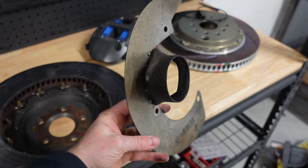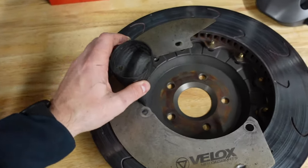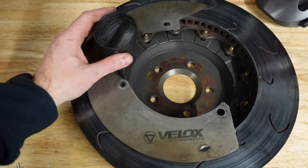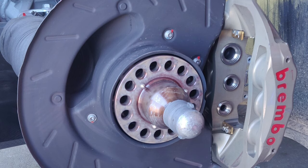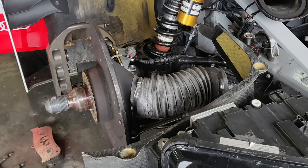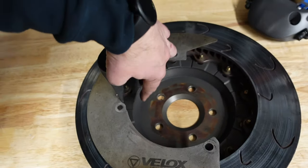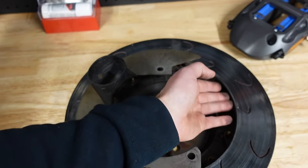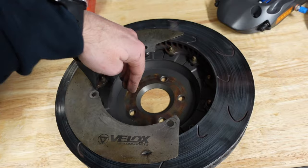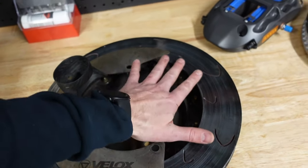Here we've got a relatively typical example of how a brake duct would attach to the upright of the car to feed air to the disc. This particular plate has an area cut out of it for where the brake caliper and everything sits, which tends to seal this part of the disc. Normally this plate would extend to cover the full inside face of the disc and also block off this area. We would have a hose connected to this duct, and we can see how the air is going to flow in from that duct into this area of the disc — which is where we want to direct the airflow to get these vanes working. It's pretty important when designing this whole system not to have air being ducted to this area and then not doing a good job of sealing it in here.